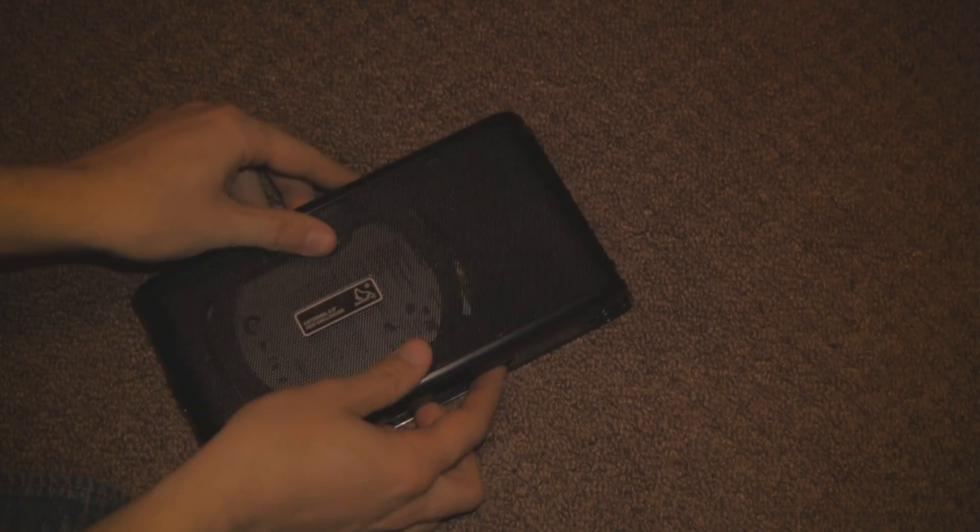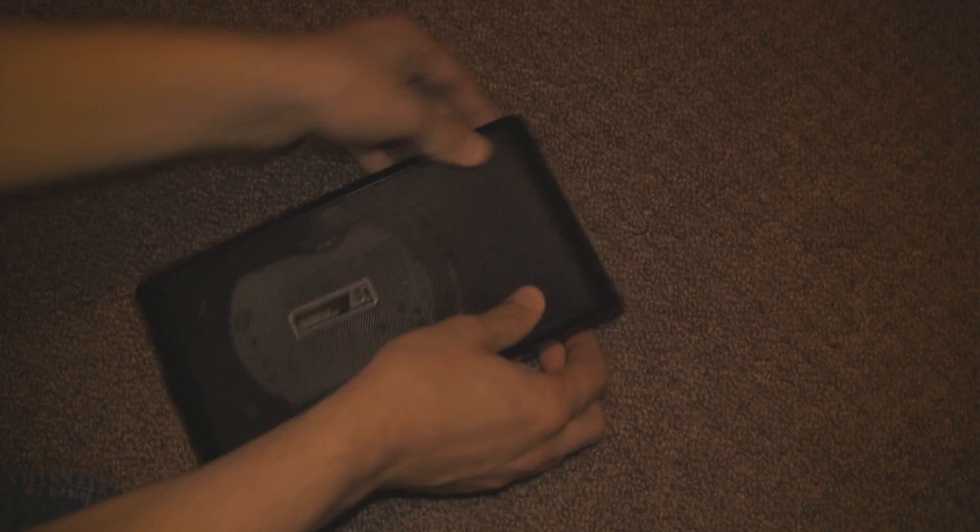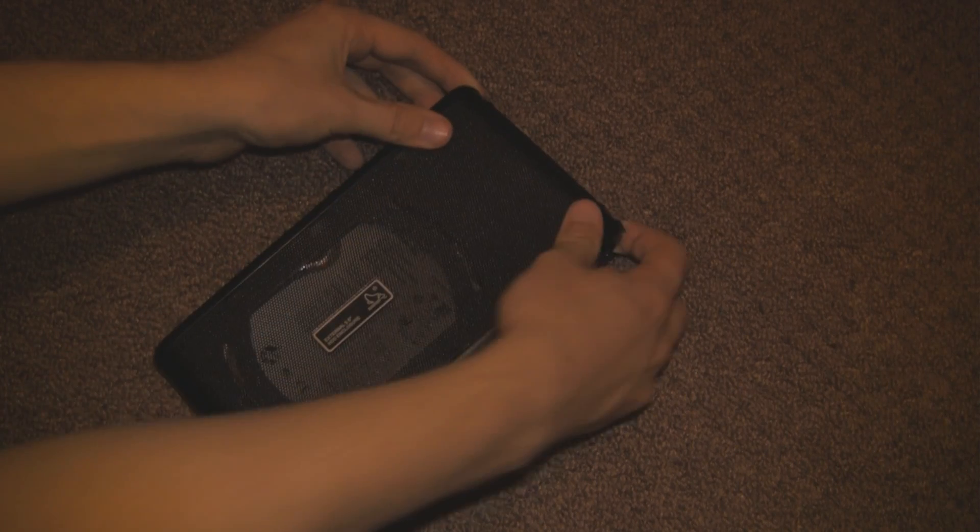You now need to put the four screws in around the hard drive and this will keep it from moving around inside its case. Once they're all in, you can put your case back together. This is very fiddly because it's got these silly plastic connectors all around the side — the clips are hard to get off and hard to get back on. So once you've wrestled with that some more, it's ready to go.